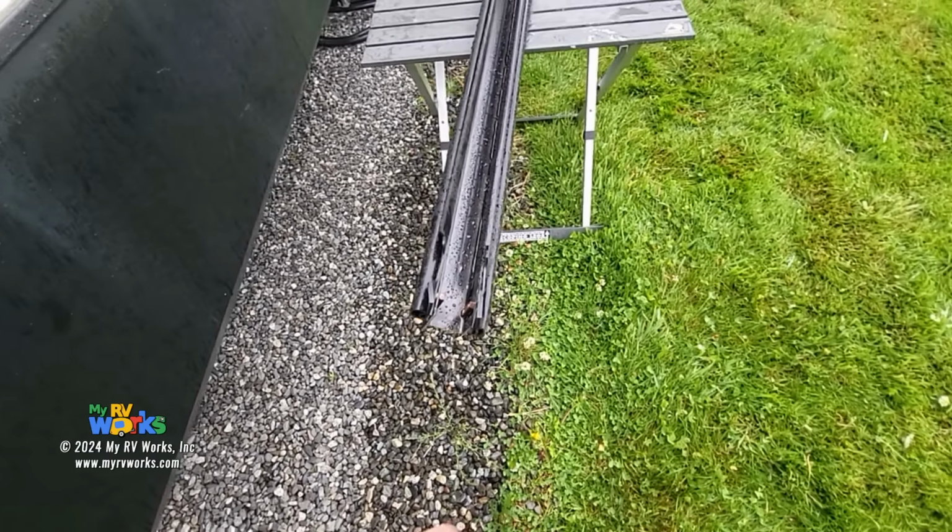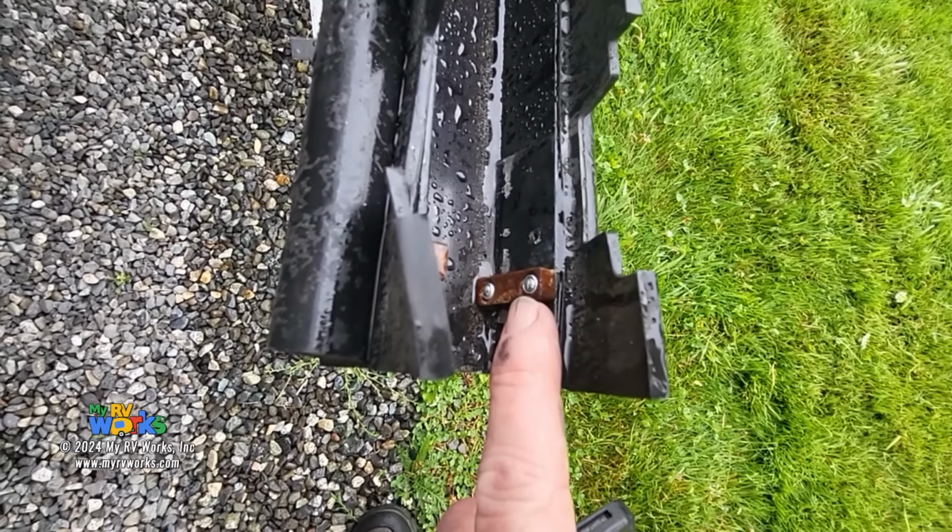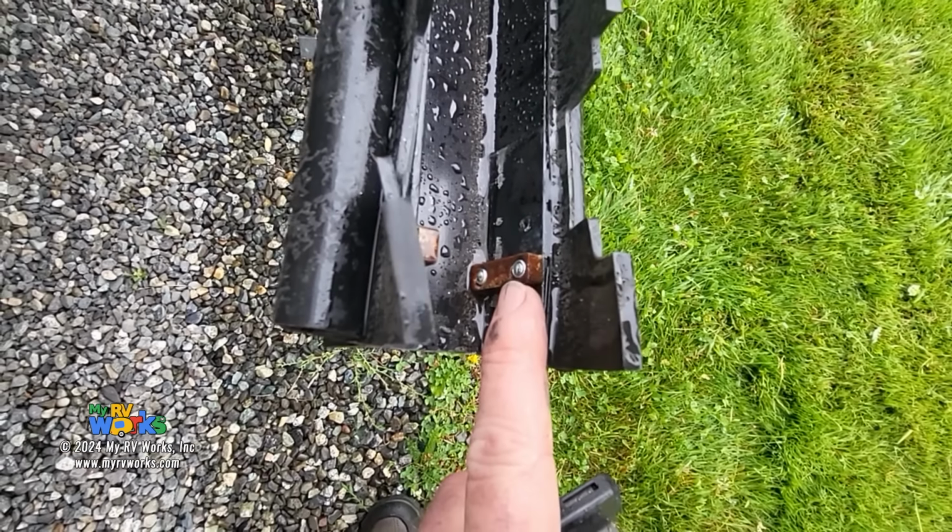So Darren's a big advocate of lubricating. They're telling you not to. Look at all the rust on there. A lot of your noise coming from your Schwintek is because this rust, this is a piece of steel, is rubbing against this piece of aluminum, and it makes a terrible, terrible squeaking sound. So get your straw right on top of this roller wheel, and squirt a little bit. And if you just study this bearing block, it'll wick itself down into these gib slots on your bearing block. Okay? So you can do all of it from the outside.